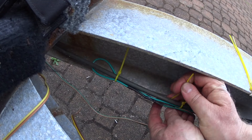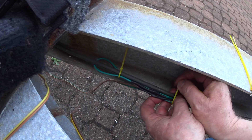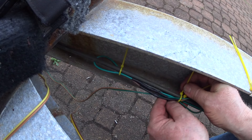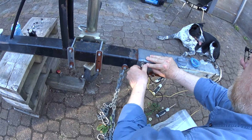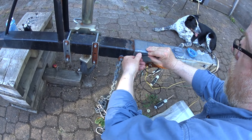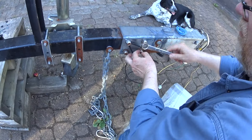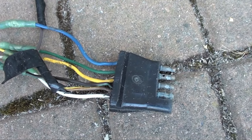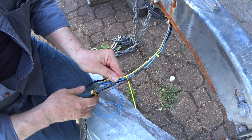You'll see here I joined two harnesses together because of the length of the trailer. This old connector is toast, so we upgraded it to a 7-pin commercial transport style plug.